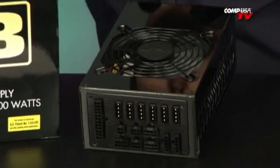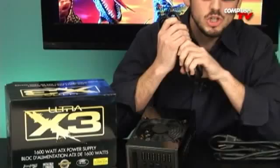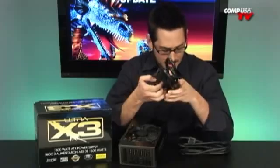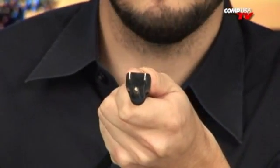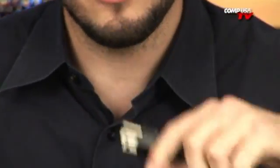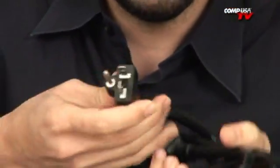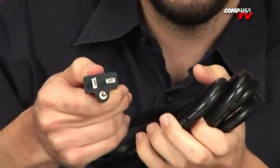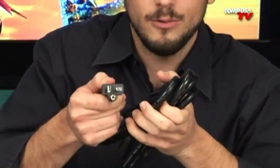There are regulations with the FCC that limit how much power you can actually push through a plug. So if you want this thing, check this out — this is the regular plug that you're used to. If you're using this plug, 1,200 watts is the maximum it will do. If you want to crank it up to 1,600 watts, you need to get one of these. You know you're hardcore when you're having an electrician come to your house to put in a dedicated circuit for your computer's power supply. That's when you know you're a true G. You actually need a separate plug for this — you're going to need an electrician to come out to set this up.